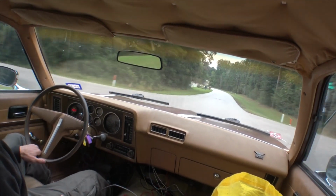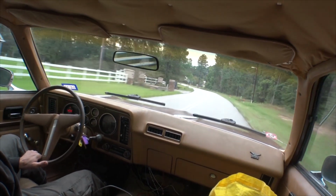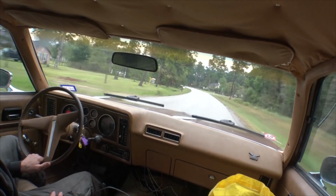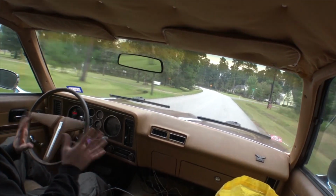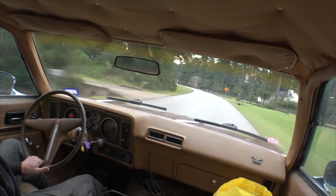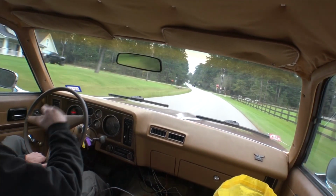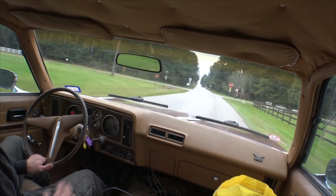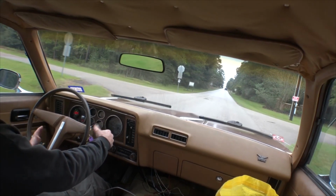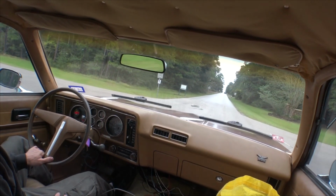It's got good torque. I know the ignition timing is way off from where it should be, especially with the LS9 cam, because this tune isn't based off the LS9 cam. It's got lots of weird overlap, I think. It'd be interesting to see the difference before and after it's optimized, and how it feels too. It feels punchy but a bit lazy.